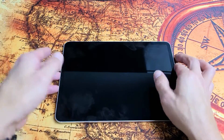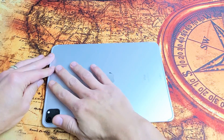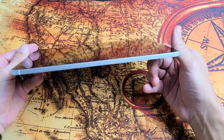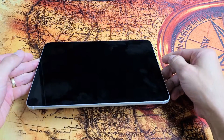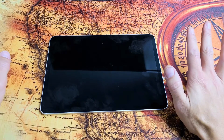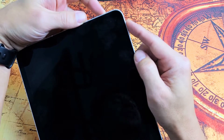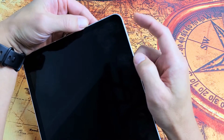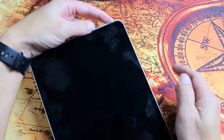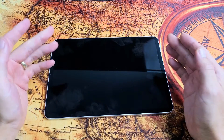For this next step, go ahead and grab your iPad. Make sure you have no case on it — take the case off — and grab your iPad naked. Go to your freezer and put it in there. Leave it in there for about 15 minutes. After 15 minutes, grab your cold iPad and do the same thing to restart it with the special key combination while it's cold. Volume up, volume down, press and hold the power button, and do not let go until you see an Apple logo appear. Then let go of the power button. Hopefully you are up and running.